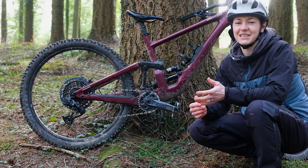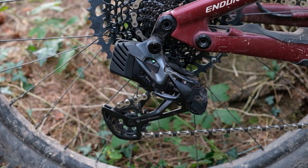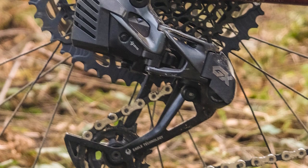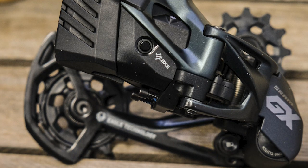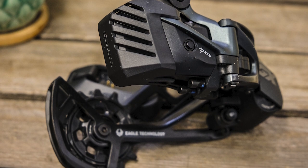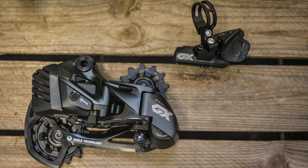Realistically, my thumb is actually a little bit small for that, and I do still find myself moving from top to bottom of the shifter paddle. The mech at the rear does look like a bit of a behemoth, but as soon as you get used to the look of it, it does look normal. The extra weight isn't immediately discernible, especially not on this bike which isn't exactly built to be light. The upper portion of the mech with the battery and motor is the heavier part, secured to the mech hanger. Thought should be given to whether you want all that weight attached to the rear of the bike — it's extra unsprung weight which will affect suspension performance, physically more weight to move out of the way when you hit bumps. But with any cassette and rear mech, we aren't in the territory of reducing unsprung weight like you would with a gearbox, so how much this matters is really down to you.